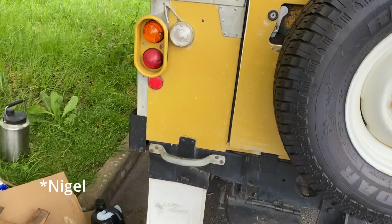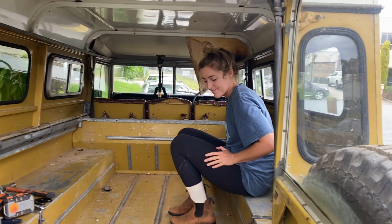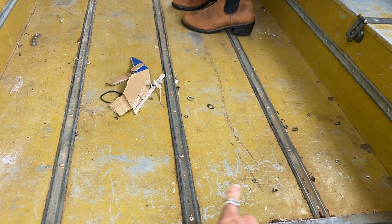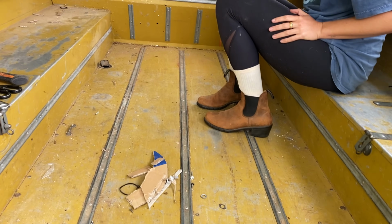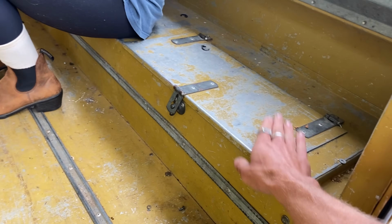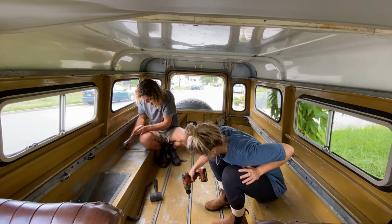All the junk out of the van. Well, some good stuff. And we're left with the bare bones. Basically have to pull any random bits out. I think I'm also going to be pulling up these guys, so we can then, the floor's already pretty scuffed, but we've got to prep the paint for us to then paint on top of it to prep it for sound deadening. And to make our lives easier, we'll also probably remove the lids just so that we've got access within them, because I know some moisture sort of gets caught in there.